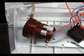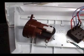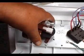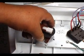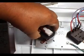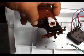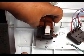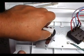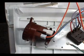To remove the first switch type: remove the hose, remove the wire harness, remove the holding screw, grab the switch, press the tab, turn it clockwise, and take it right out. To install, set it in place, turn it counter-clockwise until it locks. Screw in the holding screw, connect the wire harness, and connect the hose.